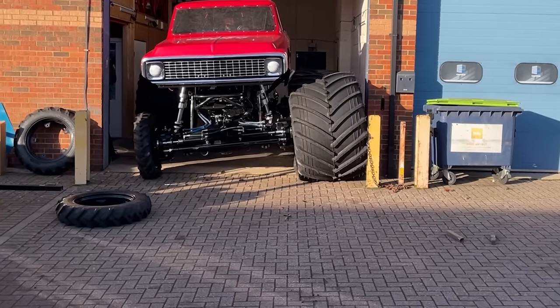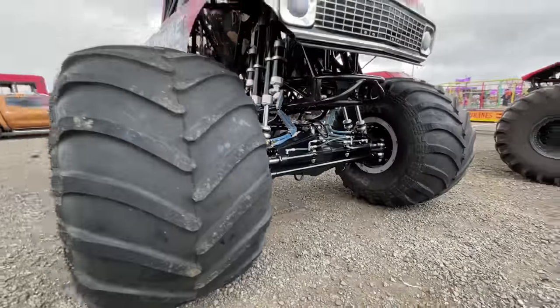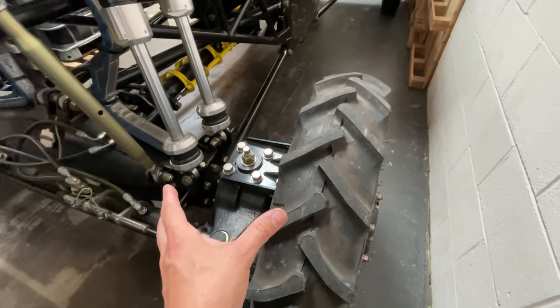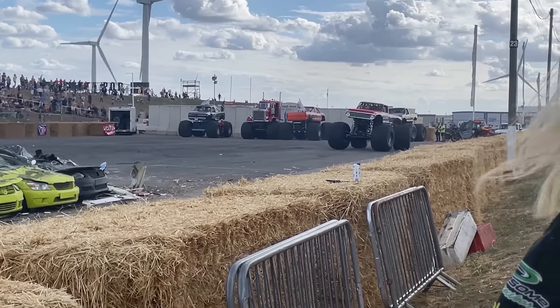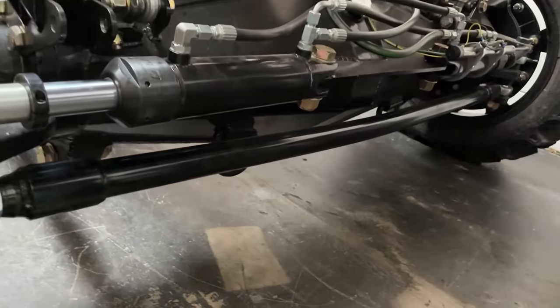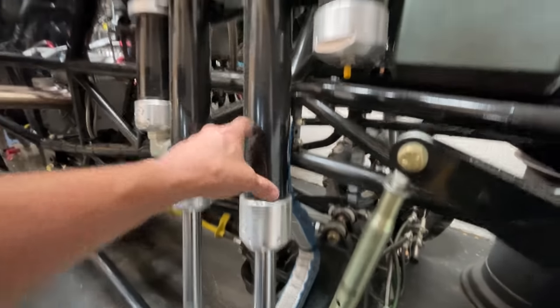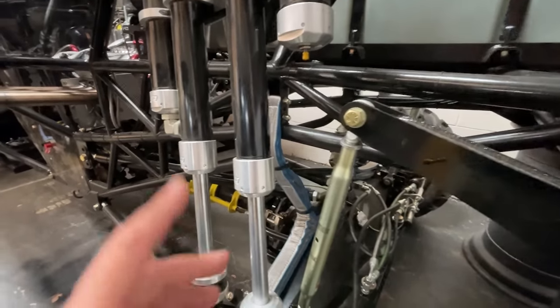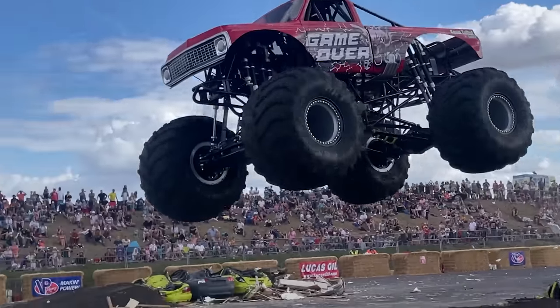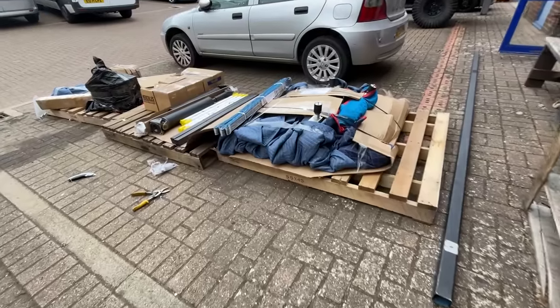In this video we're going to try and fit the monster truck into my tiny workshop. We have some modifications to sort out: the rear steering seemed a little bit on the slow side, making it take a long time to center up again and a bit unpredictable coming in at jumps. So we're going to fit a more powerful rear steering pump. We've also got a bent rear steering arm, and limit straps that are not long enough. Just had spare parts turn up, so we've got to sort all those out too.